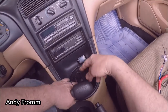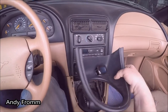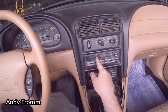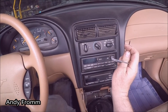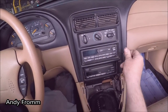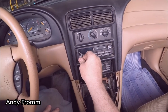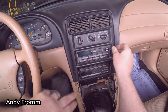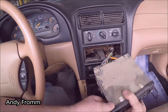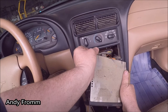Got that off and back in there, and this just pops out. Unplug your wires back here on your cigarette lighter. To get these two units out, it's easiest to use radio removal tools like these. You can do it with some small nails — slip them in there and they'll click and get where they need to be. Then they pull out and towards you. For the radio connectors in the back, push on the tab there and wiggle them out.